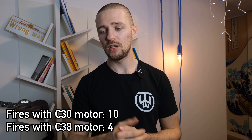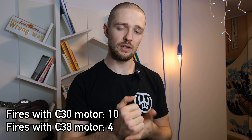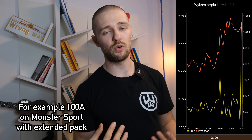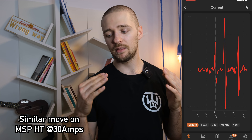There are no listed fires with bigger wheels like the EXN or the Veteran Sherman — partly because the Sherman has a 10P battery system, so theoretically 100 amps or 10,000 watts is possible, giving a lot more headroom. The EXN also has more batteries and is capable of more power output. Another factor is that the Nikola and MSP with the C30 motor option are high-speed wheels, which require a lot more amps at low speeds to accelerate. What kills the batteries most is inclines, heavy riding, aggressive acceleration, and heavier riders abusing the wheel on acceleration.